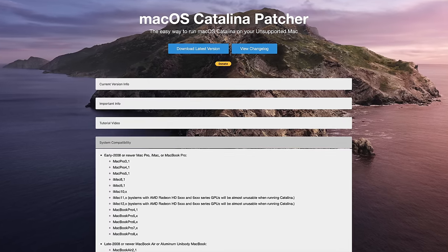Here it is — nothing fancy, nothing super crazy, but rated read speeds up to 530 MB/s and write speeds of 440 MB/s. Not going to knock your pants off, but much better than a spinning hard drive, and it was free. Rather than just sticking in an SSD and running El Capitan — the max officially supported on 2008 models — I like to use the DOSDude patcher to install slightly newer versions of macOS on older MacBooks. The DOSDude macOS Catalina patcher works really well, and I think it's the perfect fit to get this machine most of the way to modern macOS without being buggy.